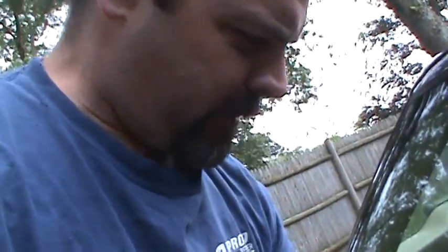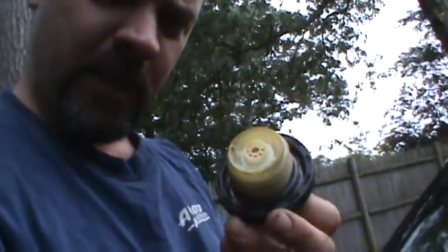That's the kind of code you get when your evaporative emissions, like you fill your tank with the gas cap open. Excuse me a second. You fill your tank with the gas cap open. That might have been what happened when the old lady was fueling up. She might have left the car running or something. That sounds like something the old lady would do. Or not putting the gas cap on tight enough after. Everything looks good here. This car had never set that code before.